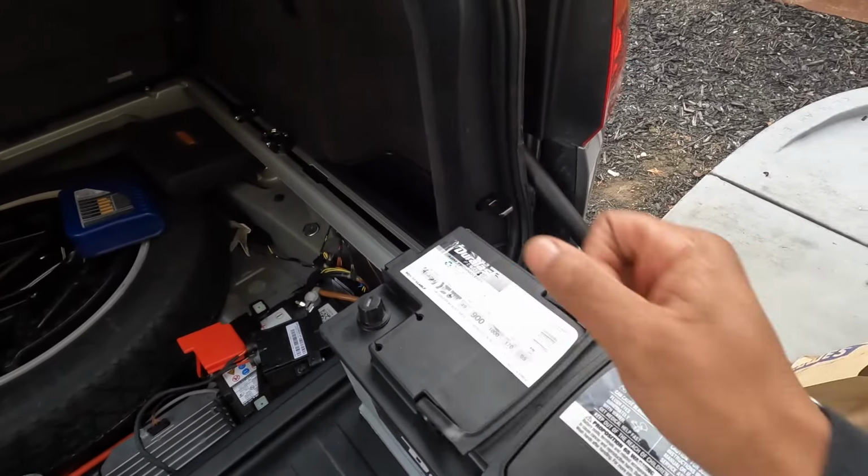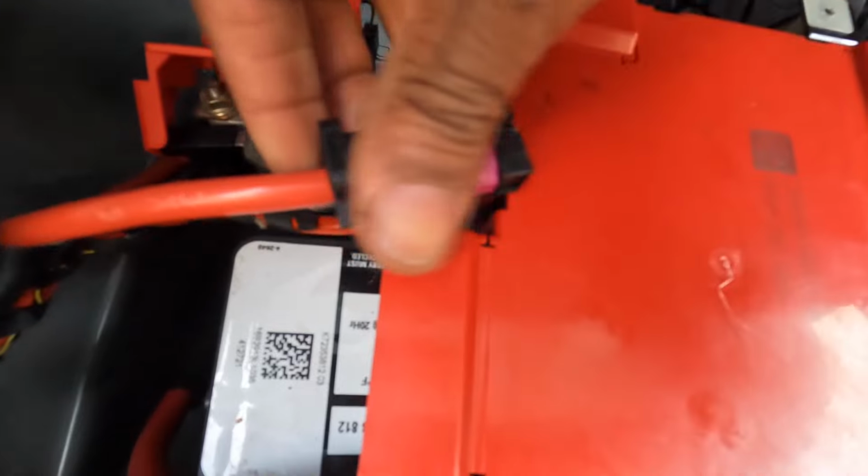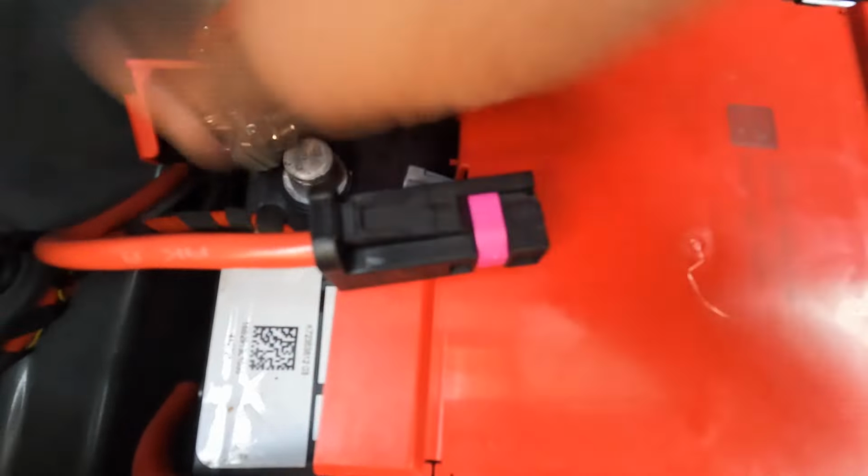And there's also a vent plug here. It is imperative you watch for this too. This has to be plugged in. This is a vent for the batteries. So check that out. All right, so I decided to go ahead and unplug these things out of here as well. Just push the lever and they unplug. Lift this out. Obviously disconnect your vent. And we can look and see what type of battery we have. You see it's a 92 amp hour battery.